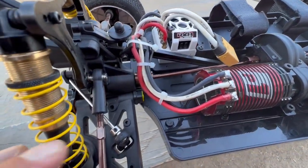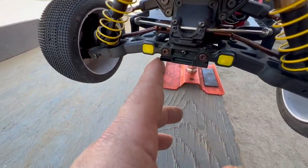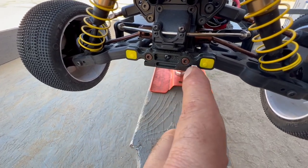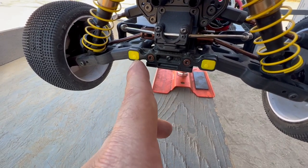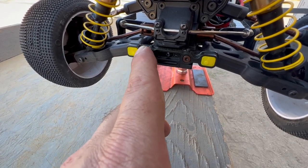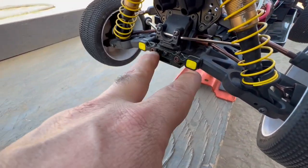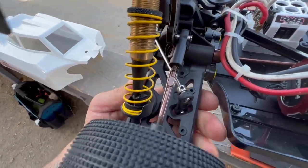Beautiful spring steel throughout. Looking at the C and D blocks — I love what they did here. There's a lot of clearance for chassis squat, and your block is not going to get raked. Of course you get normal chassis wear, but once it gets to a point it still won't hit your block. The toe blocks have 360-degree adjustability, so you can adjust low roll center, high roll center, two degree, three degree — things like that. Really nice.